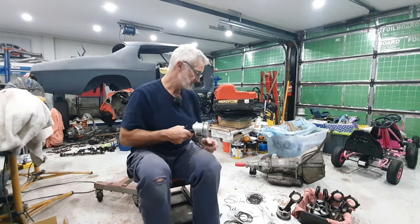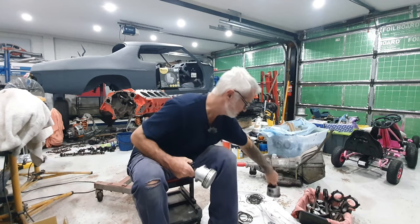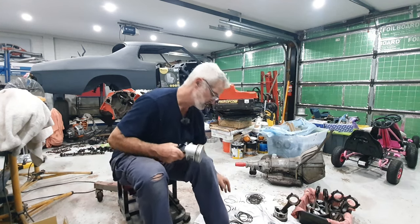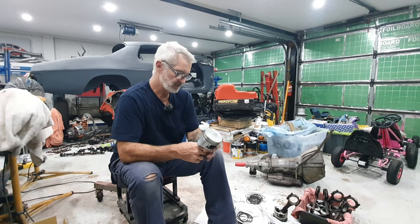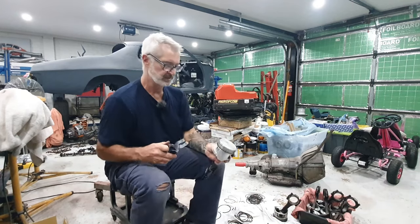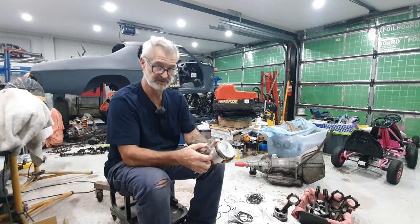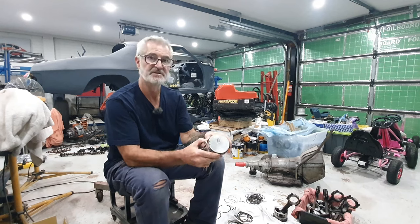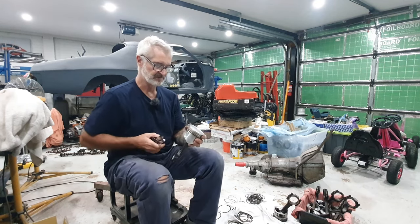I've got them down here. I've already assembled all the rest of them. They've all got their new rings on them. I've got these last couple to go here. I guess first thing you got to do is take off the rings. If you're taking off these old ones, you're not too worried about it because you're going to chuck them away. You can actually hop it back, put your thumb in the gap here and open this thing up, and you can see I can lever that off there. But all you do is end up scratching your piston.